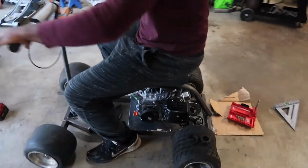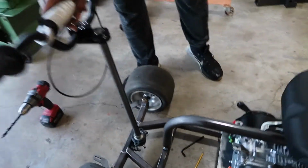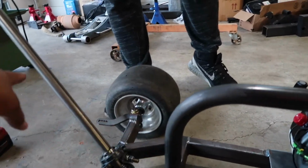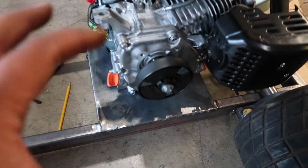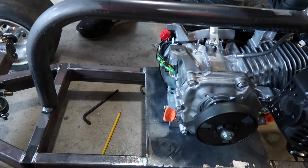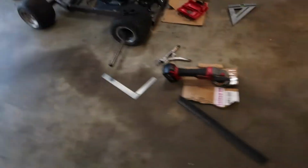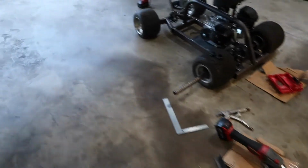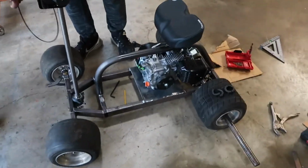All right, y'all. So we gonna work on the steering brace later, because we gonna have to mock up something. This holds the support bearing right there. So what we gonna work on now is squaring the motor up to the frame of the bike, and getting these holes drilled out and slotted, so we can get this thing strapped down. Maybe crank that joint up. So we gonna see what we can do on making some holes in the bed plate.